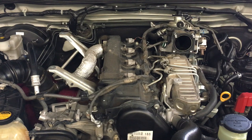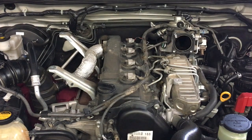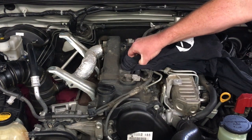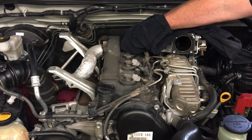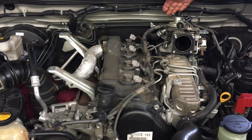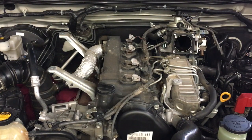Now we need the 10mm again. You can do injectors just because you've seen this video — the full length versions. Getting that wiring loom and unplugging the injectors: I like to use a rag for a bit of padding because you've got to press quite firmly on that hard plastic, and when you've been doing it for a while you get a really quite sore thumb. All the injectors are unplugged now, so that whole wiring loom — other than there's a clip at the top — will be able to neatly maneuver over here, out of the way of the whole job.